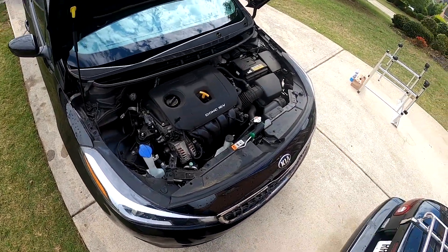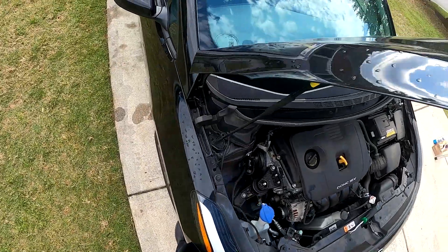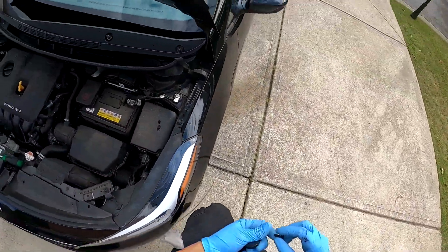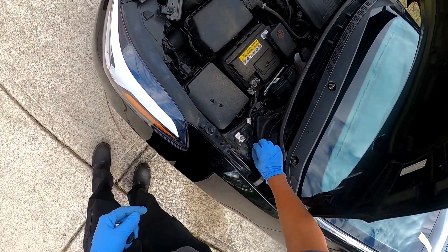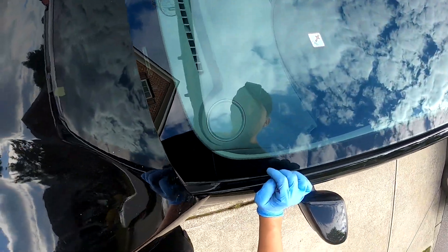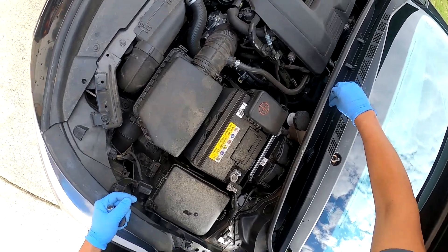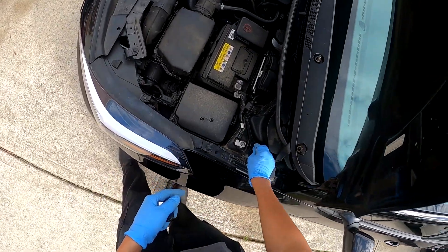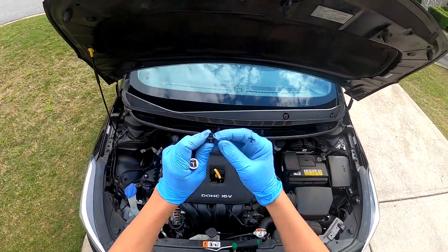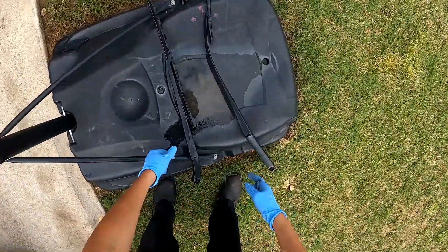Go back and put in all your clips one by one. The best way to reinstall the clips is the reverse of removal: while outside, push the bottom up, hold it from the top end, slide the clips into the two holes, then pop the top of that little hat down until it's flush. Make sure you are correct on those corner pieces — very important — or the cowl and clips will not line up properly. We were able to save all the clips. There's no guarantee you'll save every single one, but save the majority; at least one for each corner. Sometimes the old plastic makes it harder to save them.